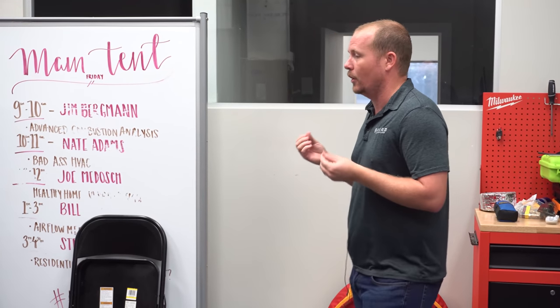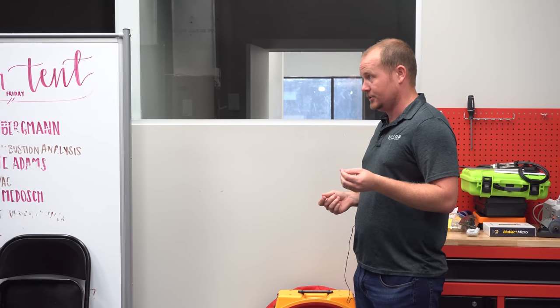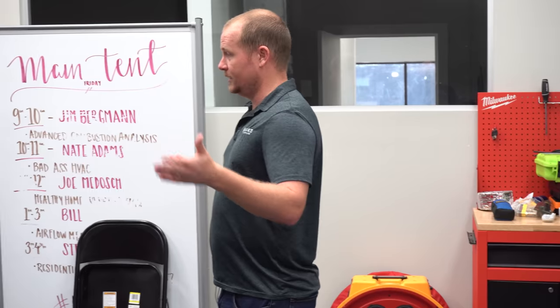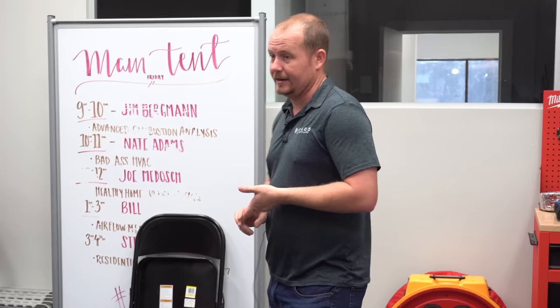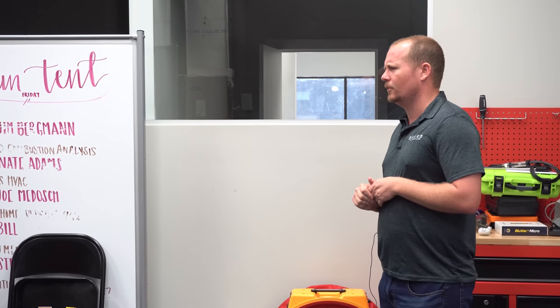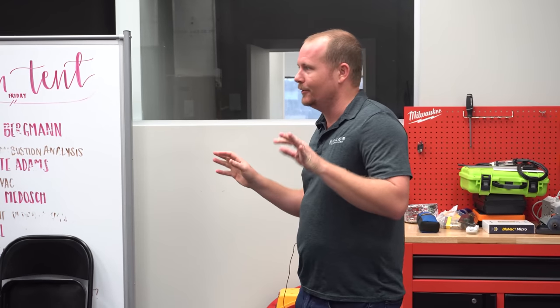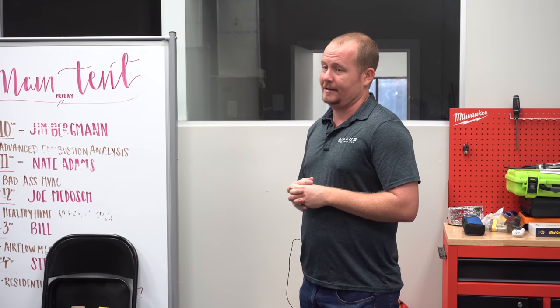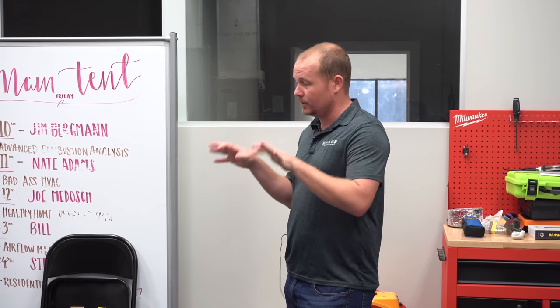For those who are new to that, the way to do it is using MeasureQuick — that's just the way to do it. When you're potentially messing with air flow by replacing a blower motor, you don't want air flow too high either. Too high indoor air flow impacts humidity and noise. You won't dehumidify as well, and it can be noisy. Right before you leave, notice if something is different — like a return grill whistling. Being practical about your system readings is the best way to catch air flow problems when you're messing with a blower motor.